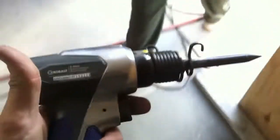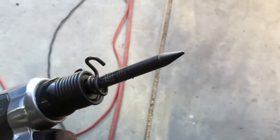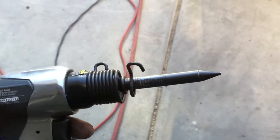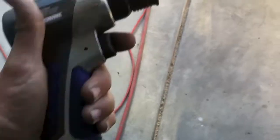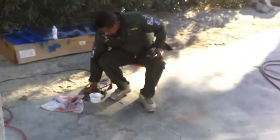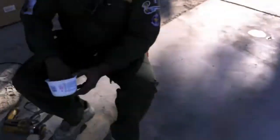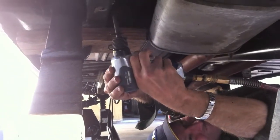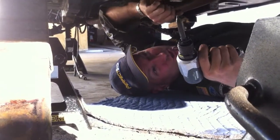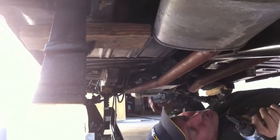I was going to call it a night but then I got this idea — I'm going to use the air hammer on her. We're going to see if I can do some serious banging with this air hammer on the end of this metal, just to see if I can break this cuff loose. That's my suspicion, so here we go — air hammer time. I'm hoping this friction is going to cause it to break free because I believe they're rusted in.